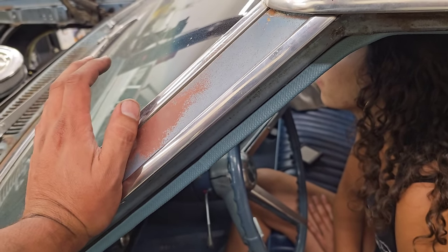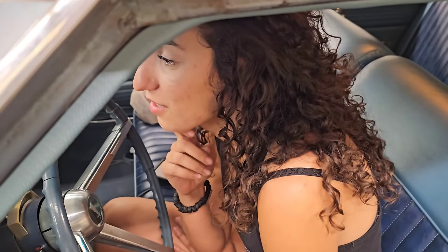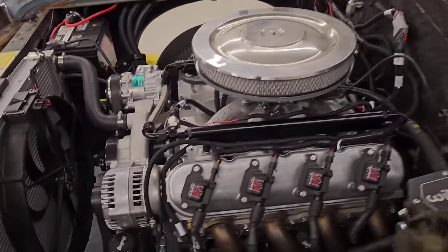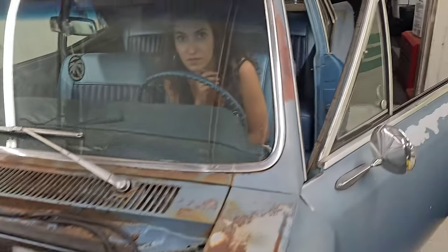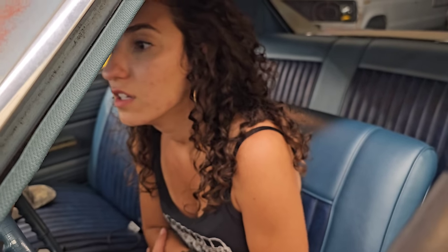And all the injectors are plugged in. Yes. We triple checked those. The plug wires are all going to the correct spot. We don't have any fuel leaks. We cycled the key already. Yeah. I don't smell fuel. So